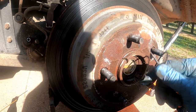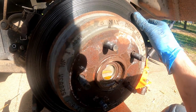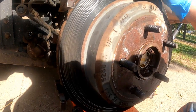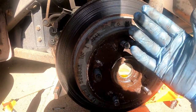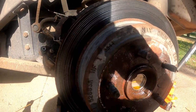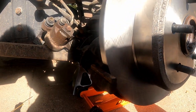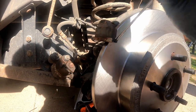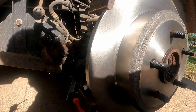Now we've got the caliper off, and again there's another O-ring, so we'll put that back on after we get this rotor off. I'm probably going to have to give this a few good whacks like the front because this one's pretty caked on there. The only difference back here is you don't have to take off the bracket, because this rotor will slide right out. There we go — that's one, and this will be number two. Now we'll put our new ones on here.